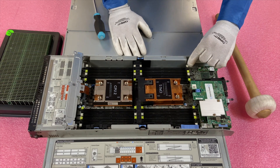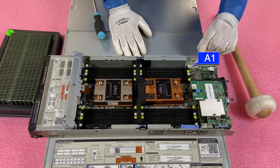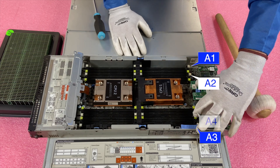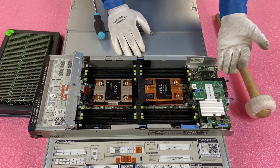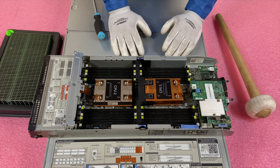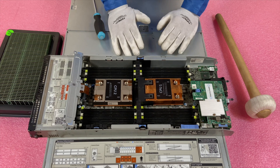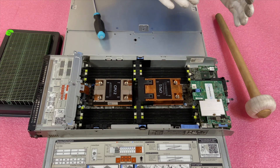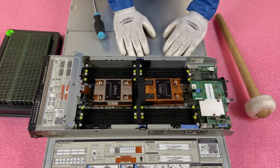The white tab indicates the start of each memory channel. This here is A1, the next white tab is A2, then over here on the outside is A3 and A4. So if you were only going to put in eight DIMM slots with two CPUs, you'd want to install them in the eight white tabs — four here and four on CPU 2. People ask why not just load the first eight slots. The reason is you want all your memory channels working evenly. You don't want to overload three channels and have the rest getting nothing. You want a nice, even distribution across every channel — that's how you maximize performance.